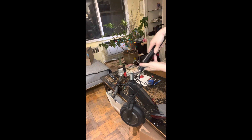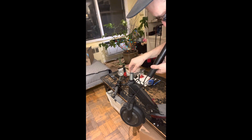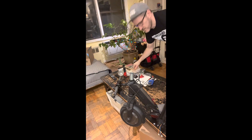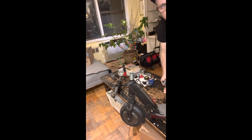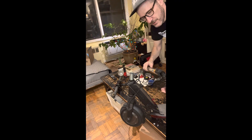Then you obviously unplug this — this is generally plugged in here. Unplug this, and then you basically twist the tube. It's lightly threaded onto the main fork, and once you unscrew it, it comes off. I'm going to use a little piece of electrical tape to pull the other wire — pull the new wire through. I'm going to tape these connectors, making sure the two leads are going towards the top.